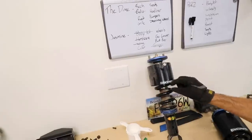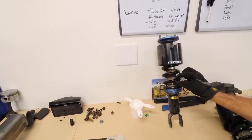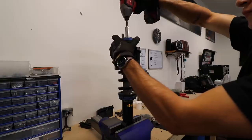That's why, for the longest time, I've been saying we need to fix the ride height, adjust things, and make it better. The front airs up and down fully, going up probably 2 to 3 inches. But the rear, when you air it up, goes up maybe 1. So it wasn't super functional, and it was also what was causing the stiffness. Because the spring was super compressed when aired up, it felt so stiff when we were driving around on it. With the new springs, we should be able to drive on it aired up and it should feel soft and normal, I hope.